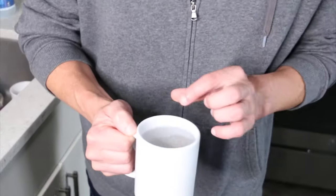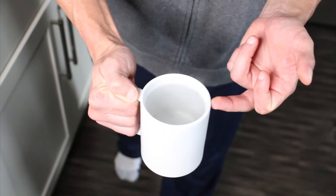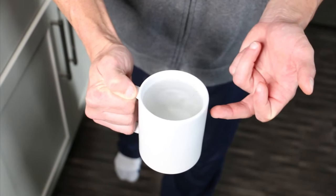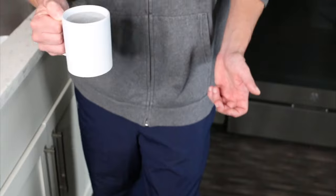After cleaning all the exteriors with soap and water, wiping everything down as best we could, running through the half vinegar, half water solution emptying the entire reservoir, and then filling the reservoir one more time with just water to get the vinegar out — it is substantially cleaner. If you look, it's clear now, and look how full the coffee mug is — it's almost at the top again, where before I was getting about two thirds of a cup every time because all the components were clogged up.